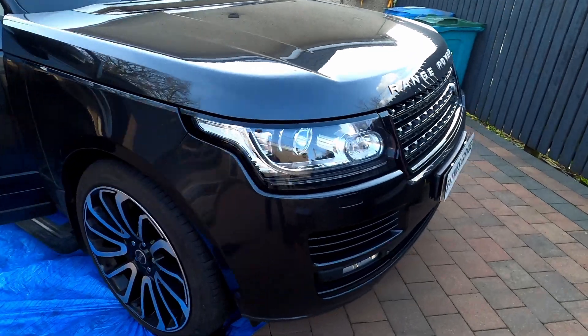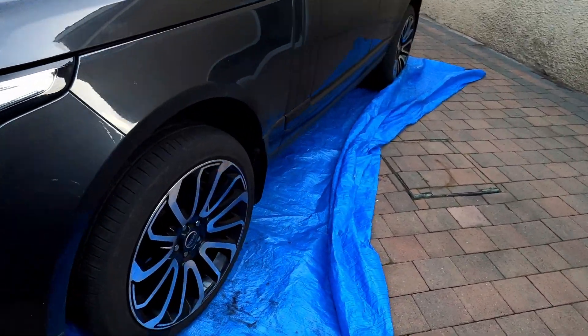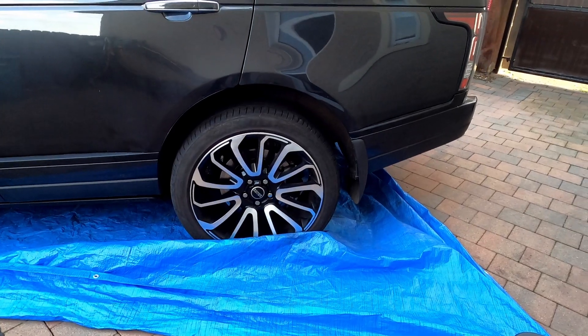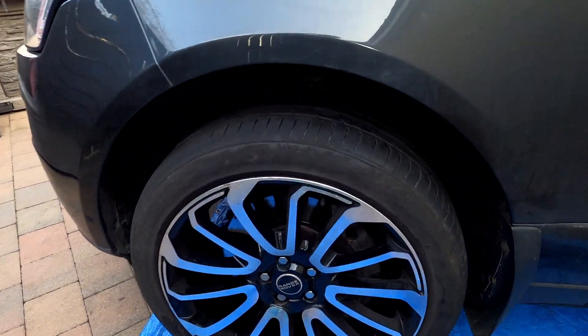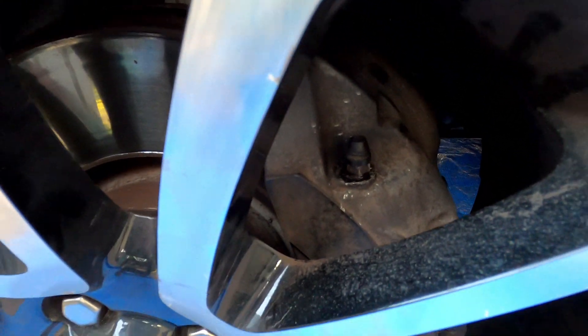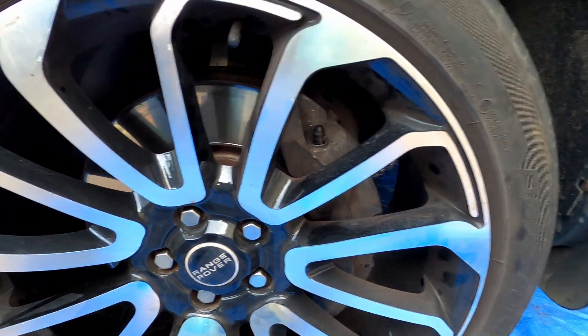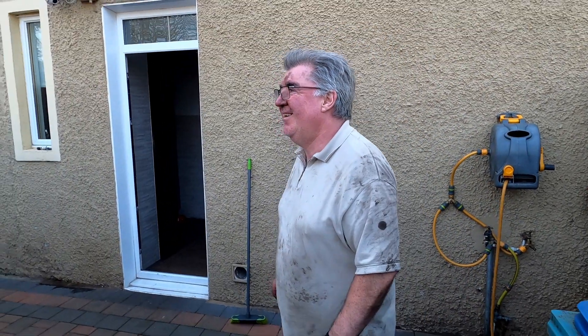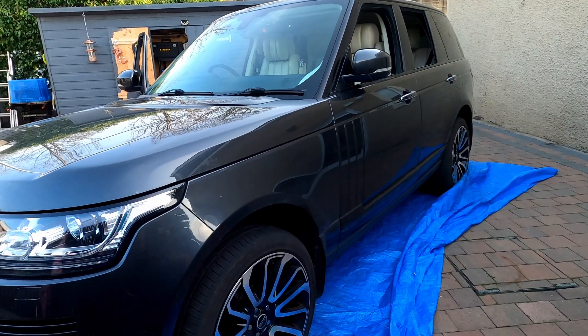So that's us finished with this L405 at Ramy's garage. We have replaced the brake fluid and two rear calipers and the actuators. We did have a problem with this caliper here where the apprentice broke the bleed nipple. So we had to take the caliper off and take it into the wee workshop - we had to end up welding a nut onto it to remove the broken bleed nipple. However, all is good now and that's us ready to rock and roll. Any else you want to add? My back's broke. So that's it for this - see you all later.